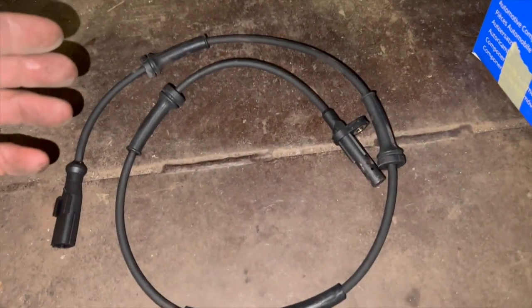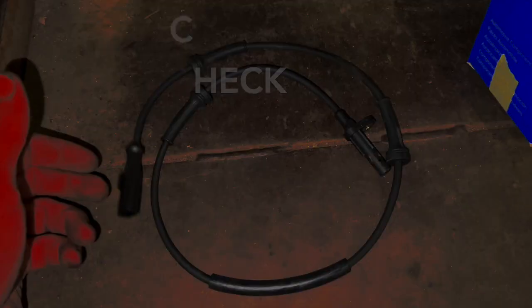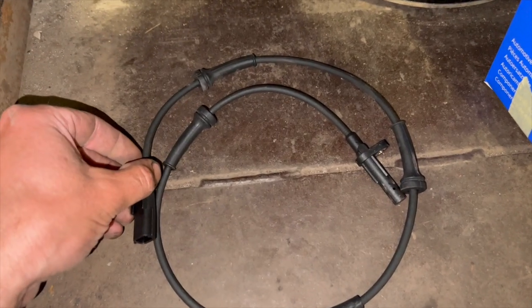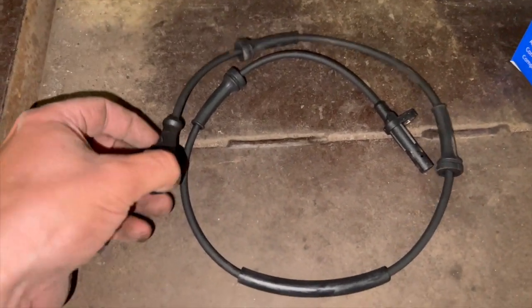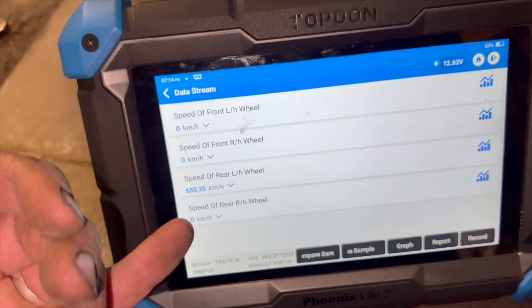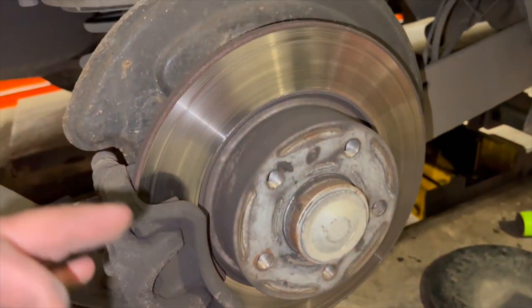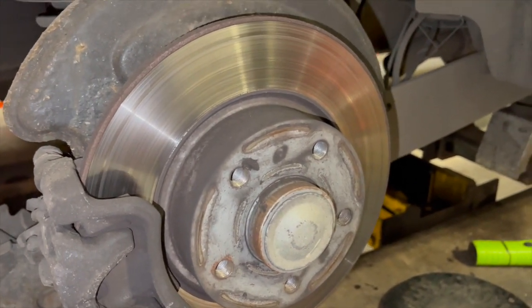Just got the wheel off now. I've got a new ABS sensor — if you're interested or need one, check the links in the description below. I've got one on standby; I'm pretty sure this is going to be the fault. Before taking the sensor off, we can just plug it in and check on the diagnostic machine with the ignition on — if it takes the reading down to zero, that'll help us prove whether it's a fault with the wiring before the sensor or not. I'll just run you through where the wiring all plugs in and where the connector is, then we'll swap it in quickly and see what it does on the diagnostic machine.